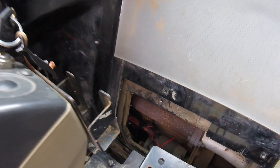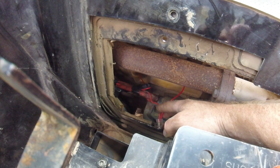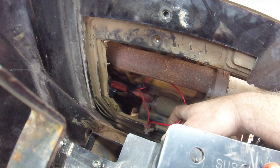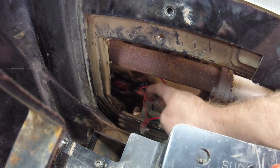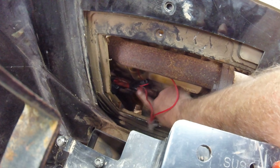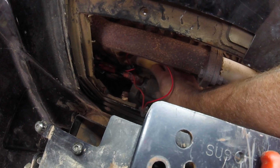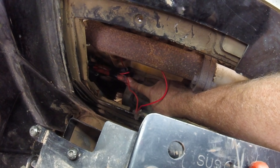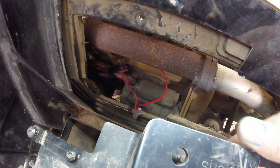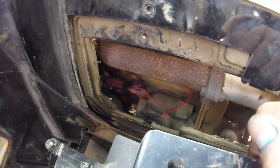So what happens on these is this wire is connected to your key. When you turn your ignition on, you get power coming through this wire. I tested it - there were no volts without the ignition on, but turn the ignition on and I've got 12 volts coming through here. The 12 volts come through connecting to this connector, which is then energised, allowing the full 12 volts to flow through. Once this is energised, it allows electricity to flow through from this one, which is connected directly back to your battery - and once the current is flowing through this wire, your starter motor kicks into operation. So if you don't get that click, it's a case of finding out what the issue is with the starter wire.